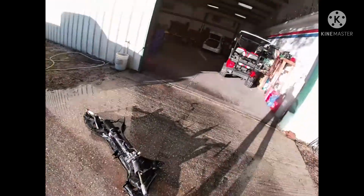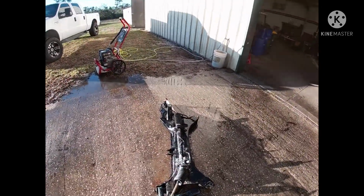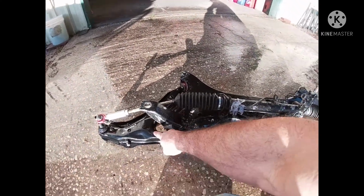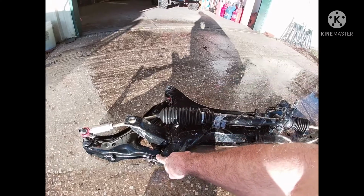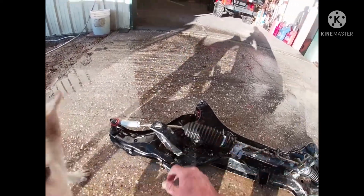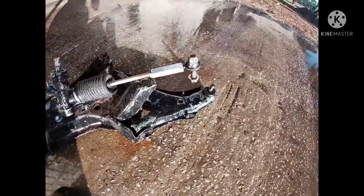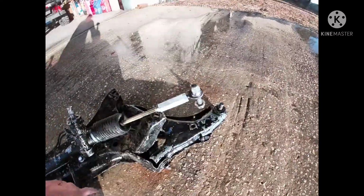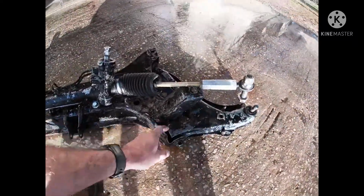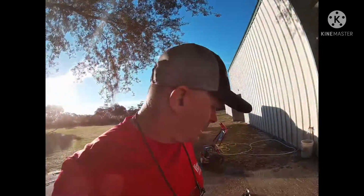But anyway, I do remember now, looking at this thing, this is a new A-arm, and I replaced this A-arm and these bushings on this side because I had been in a crash at some point, and that's the reason why these are in good shape. And I also repaired the ball joint. So as you can see on this side, the ball joint needs to be replaced, and this is the original A-arm. That's the reason why these, I think, are just old, and they just started cracking.